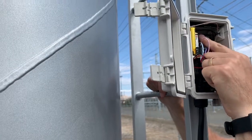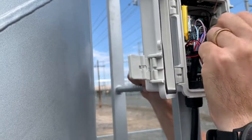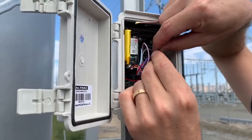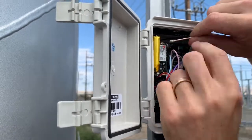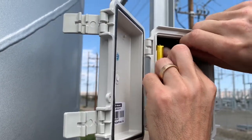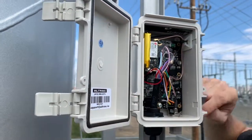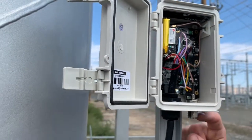To start, you just pop the black wire up very gently and that'll come straight off. Pull the cap off of the tan coax wire. Then replace that back on there so you're not shorting anything, and lining this up, pop it onto the modem like so. Now instead of the internal antenna, it's going down to the coax on the outside.